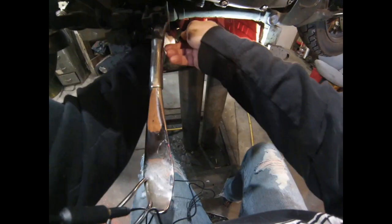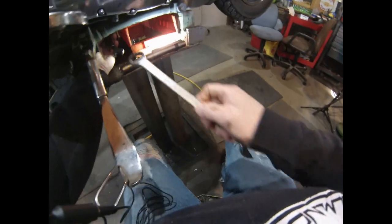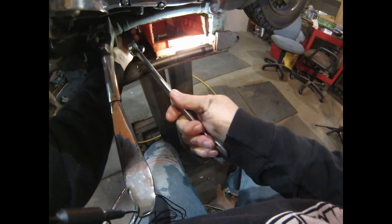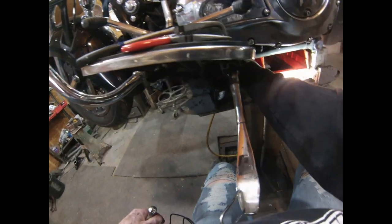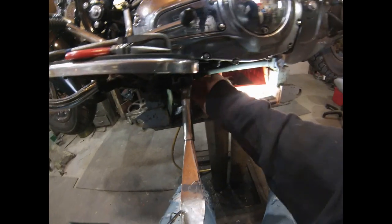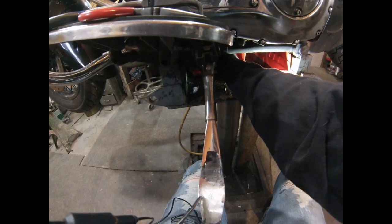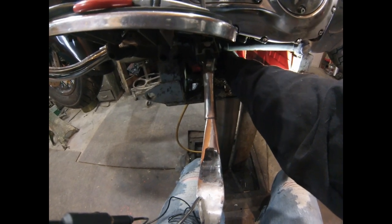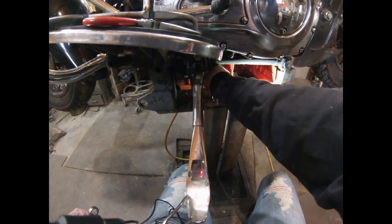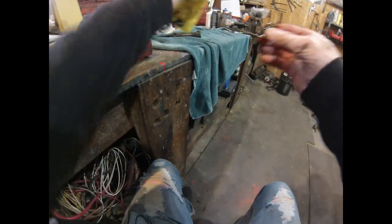What I was talking about earlier — you've got to remember you'll never get all four quarts out of there; it's just not going to happen. By the design of the cavities that this stuff sits in, you just can't get all the oil out. But your manual says four quarts and the bike does hold four quarts — you just can't get it all out. That's our puke issue: you overfill it, it's going to puke. As I said in previous videos, start at three quarts and four ounces and get to know your bike.